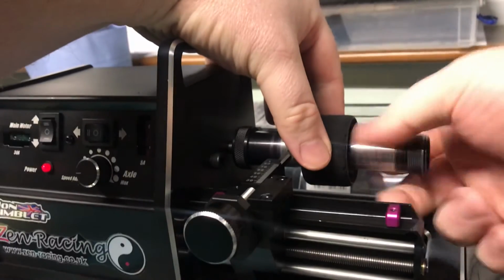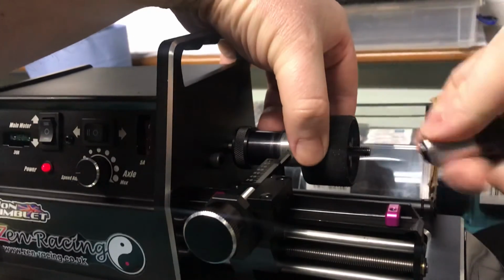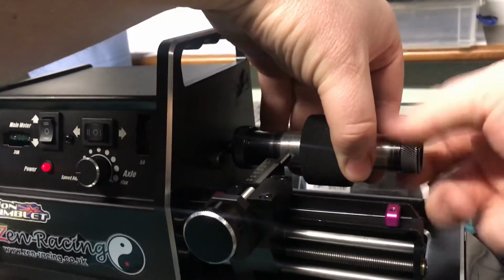So then I'll take that off and I will true all of the other rear tyres to that same size, and it will take more or less material off of each one depending on what size they are. And once I've done all of the rears, I will adjust the truer to 2mm further in, probably slightly less than that to start with. True the front tyre, measure it, make sure it's the diameter I expect it to be, and then I'll true all the fronts to that. And then they go in the box and they're ready for the next meeting.